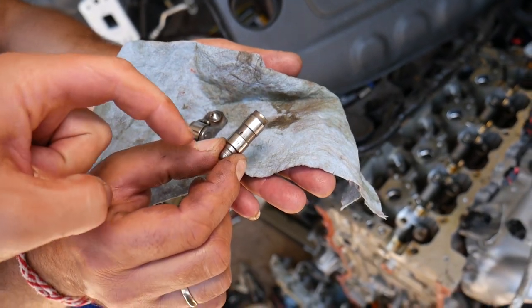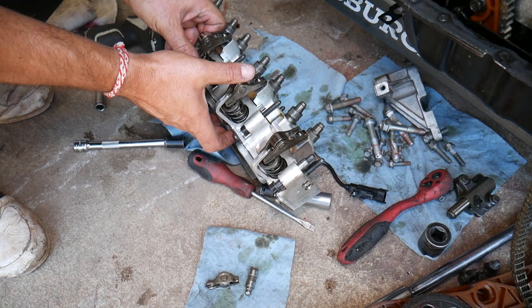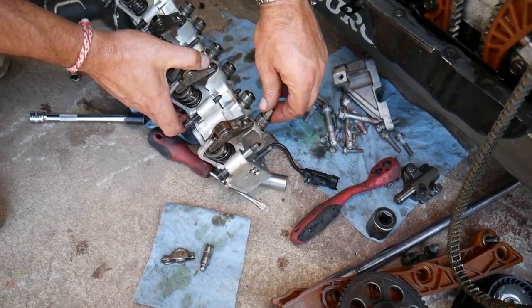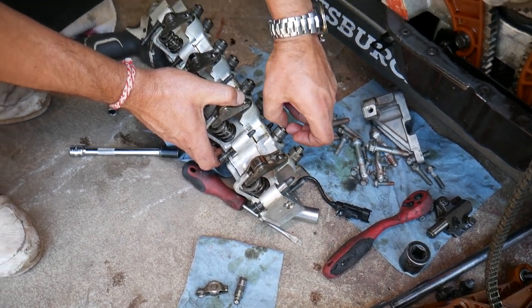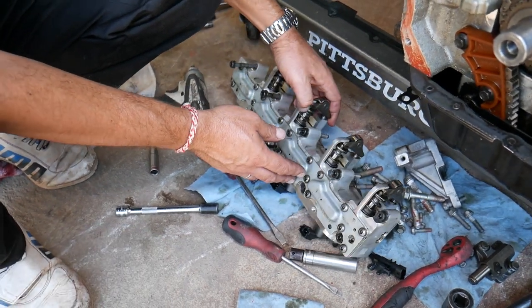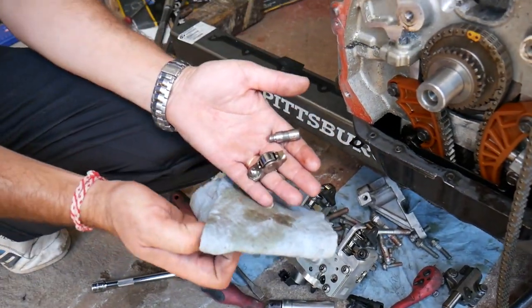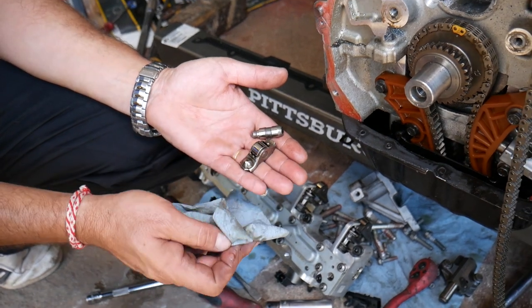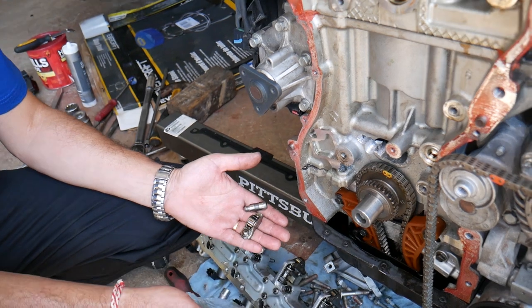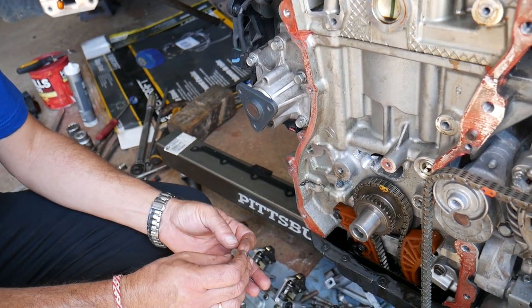For the intake side, these are also hydraulic lifters operated by oil pressure, but they are not individually replaceable - you have to remove and replace the whole block. We have the link in the description below if you need to purchase one. That's how you do it - unfortunately it's not serviceable. Thank you for watching, please subscribe to the channel for more videos. If you need help let us know. For putting it back together you'll need torque specs - we're planning a reassembly video as well. See you next time.